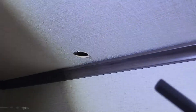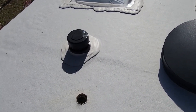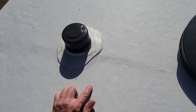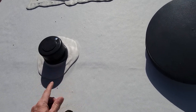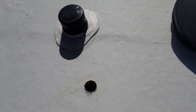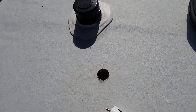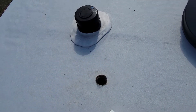That's it for down here for now, so let's take it up on the roof. I've drilled a one and a half inch diameter hole through the roof. My original pilot hole was right here, but unfortunately that's too close to this vent cap. So I moved the outside hole back about four or five inches so this antenna will clear it. If you're doing this on your 397, you might want to drill that inside hole back a little further from the wall than I did.